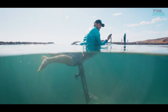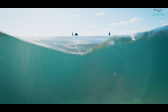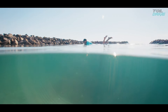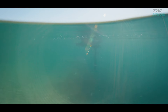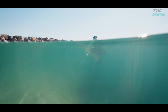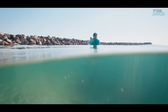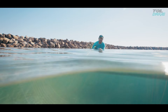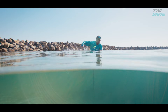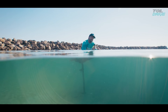I'm going to paddle too slowly and it cuts out. Remember, if you're trying to paddle, depending on the setting you've put in your Foil Drive — I've set mine to cut off after 300 milliseconds. So if I'm going to paddle, I need to paddle a little bit quicker than a really slow, lazy paddle. If I paddle quickly, I can maintain link and it'll work perfectly.